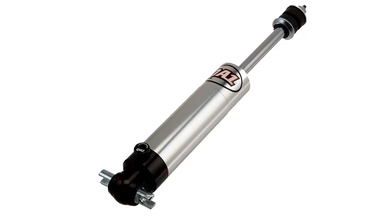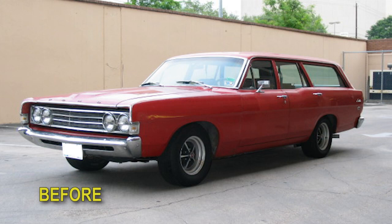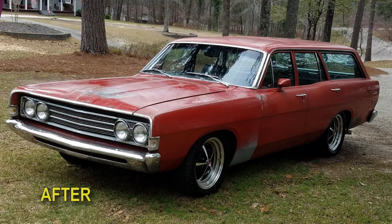So if you put a set of 720 coils on your car — which a lot of guys talk about — your gas shocks are actually going to add even more spring rate. The two places I know where you can get a fairly decent non-gas shock are QA1 and Viking; both sell non-gas shocks in a variety of applications, even for the station wagon — look for it under Ranchero because they're the same. Look to a hydraulic shock: a gas shock will raise the car a little and ride a lot more rough. When we took the gas shocks off the '69 Fairlane, the nose dropped about a half an inch, so switching to QA1s or Vikings could quickly lower your car without doing anything else.